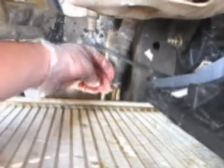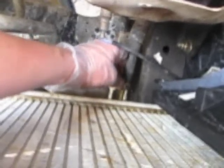The last little hose is down here. It's this little metal piece that comes from the radiator, and you'll see a flexible rubber hose right here, so you want to disconnect that too. You have one on the side and one on the other side under the fan, and they're pretty annoying. Just muscle through it and get them off.